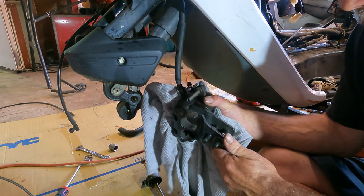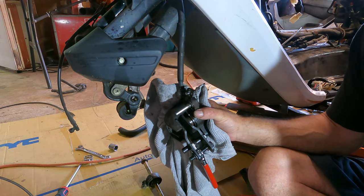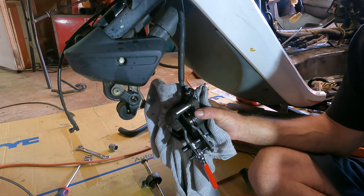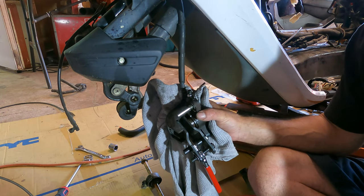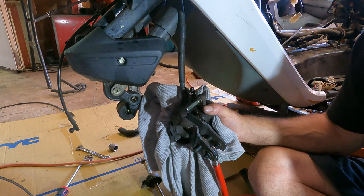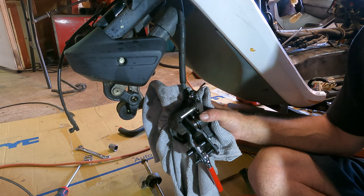You missed some steps of putting on the rear wheel. I used a breaker bar ratchet on the rear wheel, 24 millimeter. Ended up bumping it a couple times with my impact, just to make sure it's good, because I didn't have someone holding the weight down and keeping the rear wheel from moving. And then, of course, after that, I took the harness off, put it back on the tripod, and you got to see the exhaust going on.